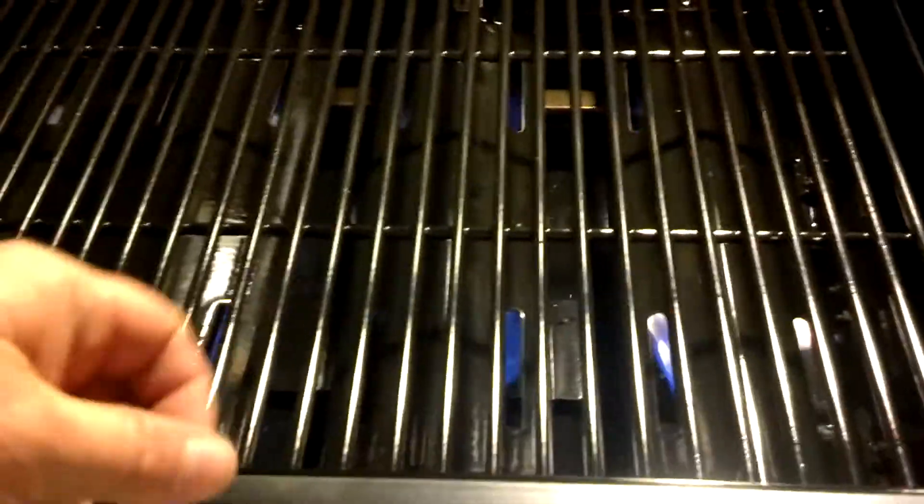The trick was to replace the spuds — well, I actually drilled out the spuds. I bought replacements but I didn't need them. This new grill has the burner tubes that pull out, which allows a lot easier access to the spuds.